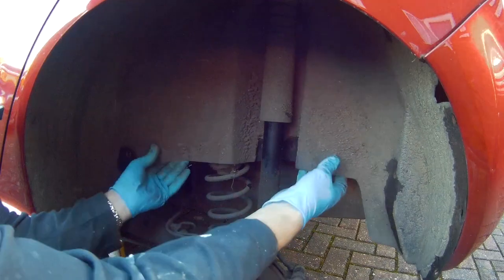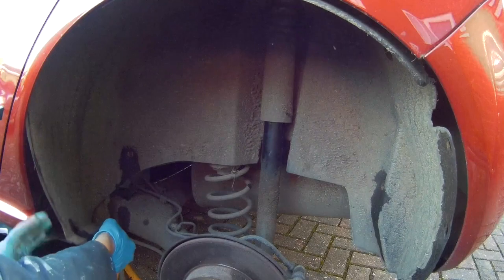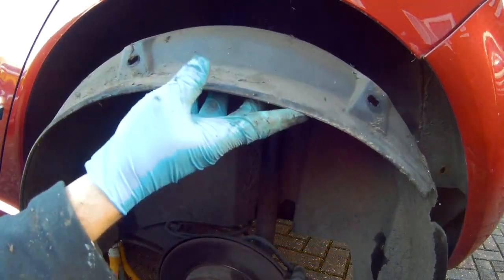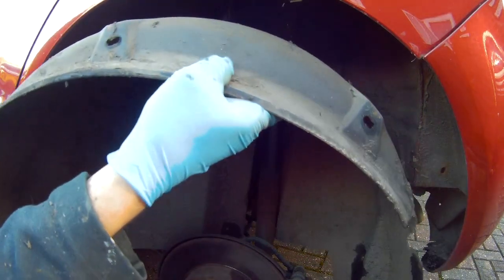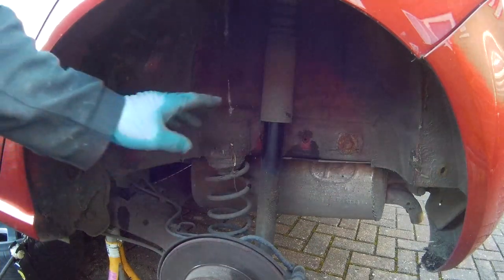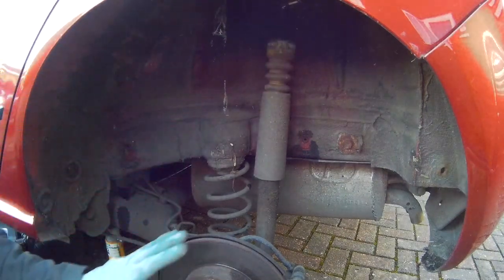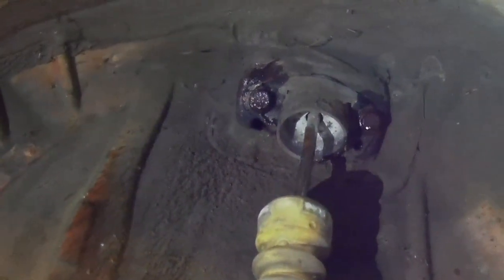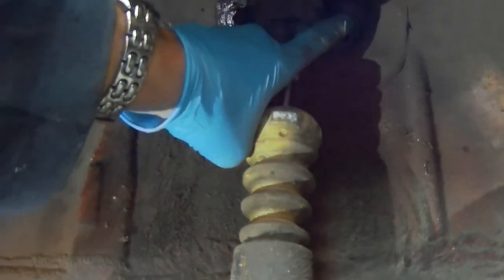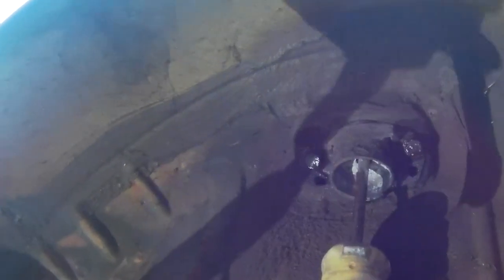Once you've done that, it's just a question of waggling the plastic panel loose a little bit, pulling gently down, split where the strut goes, to allow you to bend it around and remove it. Put the plastic arch to one side, then reach up at the top of the strut and pull the bump stop down, which should just slide out easily. If we look up into the arch, we can now see the strut mount and the two bolts that you need to remove. These are 16mm bolts, and you'll need a socket wrench with a long extension on it, just to make it that little bit easier.